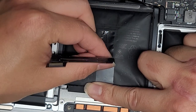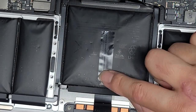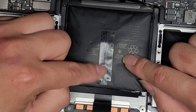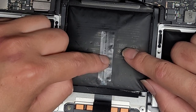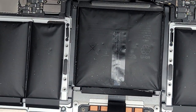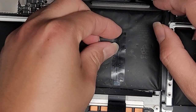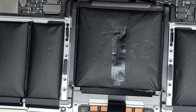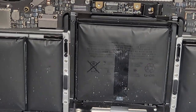It's a little extra awkward with the inflated battery. The adhesive is stuck to the battery, so there's no adhesive stuck on here anymore. You don't technically need adhesive to hold it down, but I'll put some back just so it sticks in place and doesn't wiggle around. Anyways, let's see — we are going to have to take out a bunch of the motherboard screws.